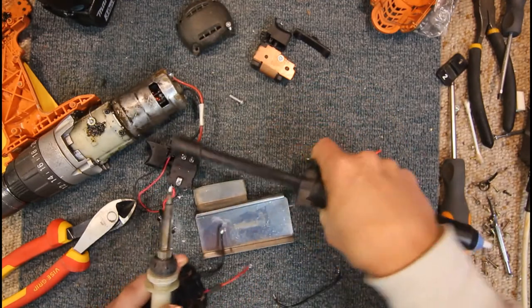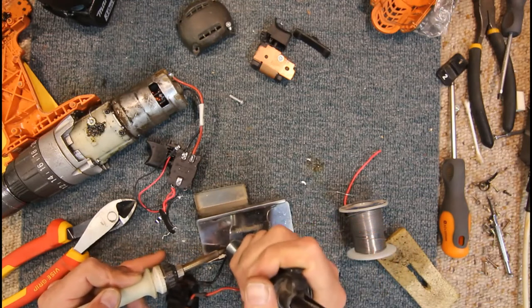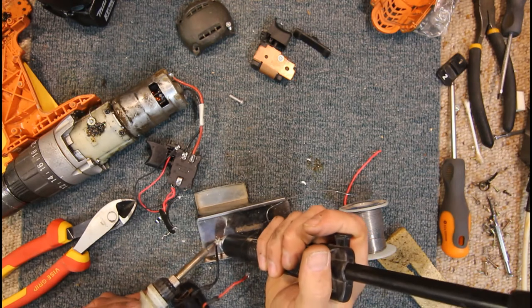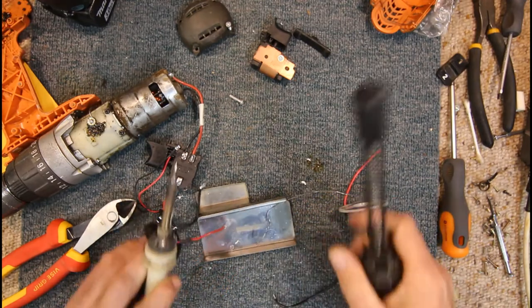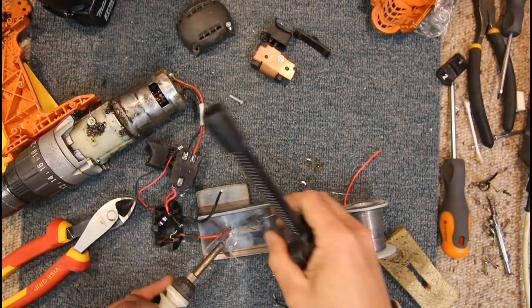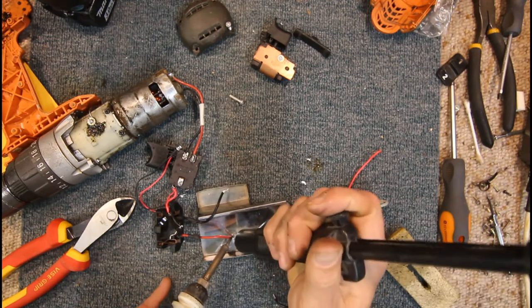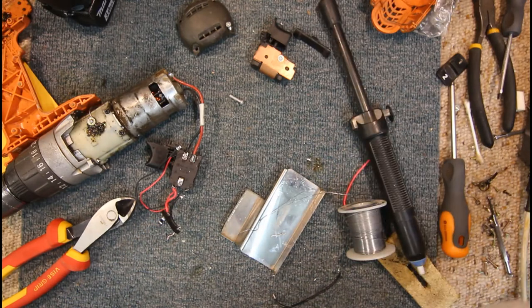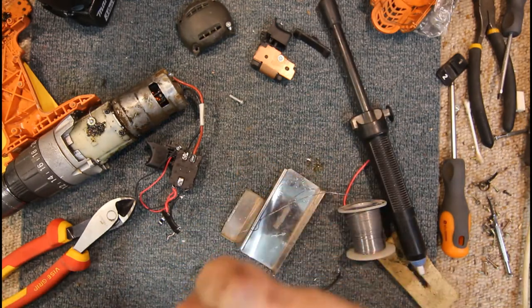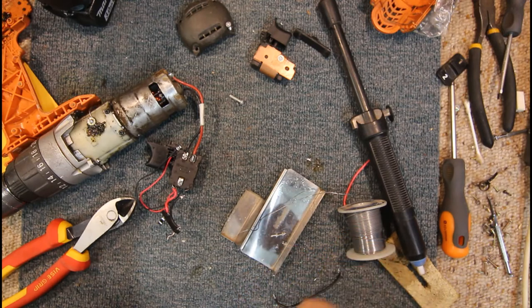Again, we'll sit these on something metal, we'll suck the solder off these old wires. Much as we can. Come on. Get in there. Okay. Suck the wire up the solder sucker. So now we've got that fairly stripped of solder. We probably could get more off, but that'll do. Try and twist those strands back together and flatten them out, make it nice and neat,